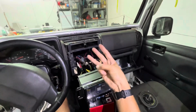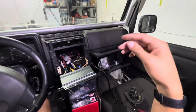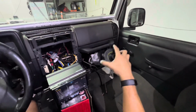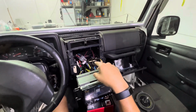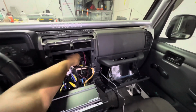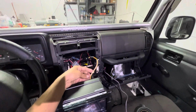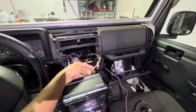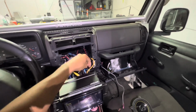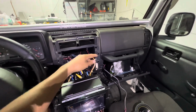After 3 wiring jobs, a new adapter clip, hours of bench testing, and building test systems to figure out what this glitch is, I just found it by shoving the head unit into the dash. You see this wire here with this clip? That's my power wire to the amplifier. I tested for power to the amplifier via this wire here, which used to be the wire that powered my head unit also. I separated them as part of the process of chasing gremlins through my electrical system here.